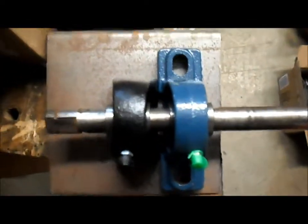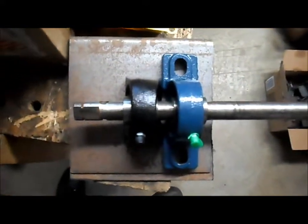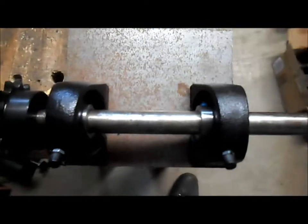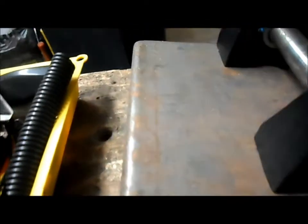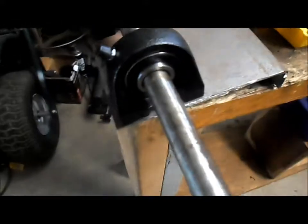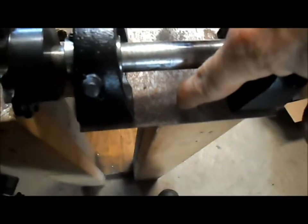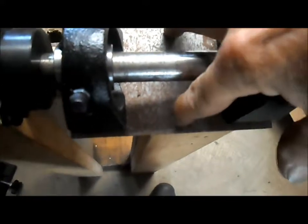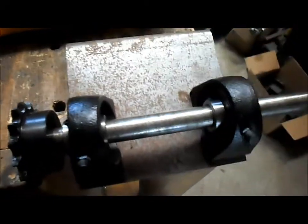It's just what we needed to tuck up under the bike. This is pretty close to how our jack shaft is going to be set up. We'll have the two pillow blocks bolted to this plate, and then we'll bolt this plate through the trailing arm and through the motor mount to lock them all together.